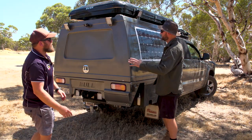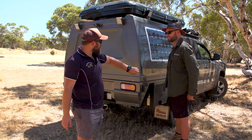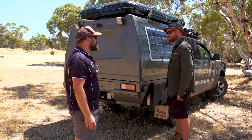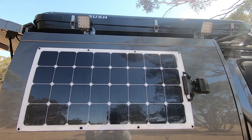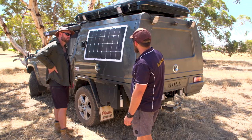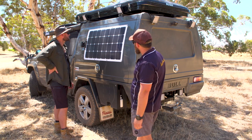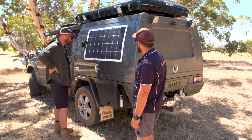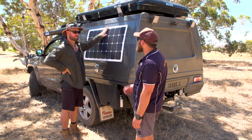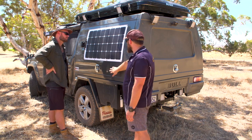This whole canopy opens up three ways — I went the three-door one. This side is the simplest, just the cargo area, and the rest gets high-tech from there. Before we go inside — I've got a panel on both sides, 120-watt Jaycar panels going straight to my BMS Manager 30. They're not the best — they just don't give the oomph that a good charger needs. I have an auxiliary panel on a 10-metre lead that gives it what it needs. I've put insulation on the back side of the panels to try to keep them cooler.